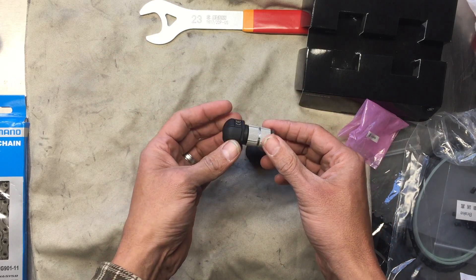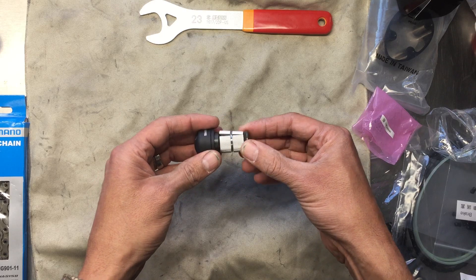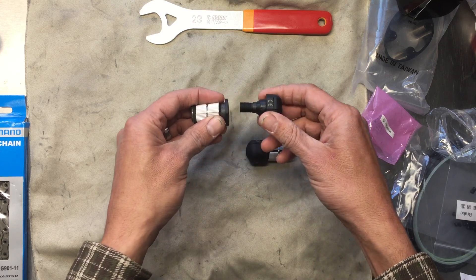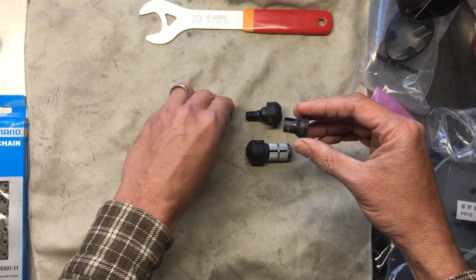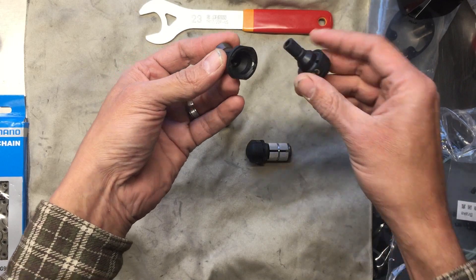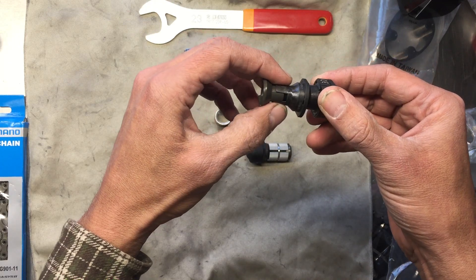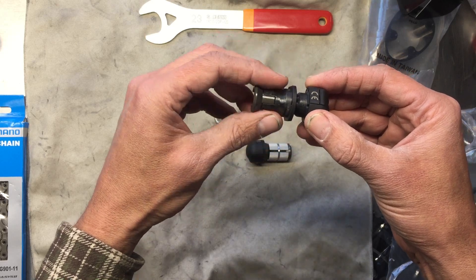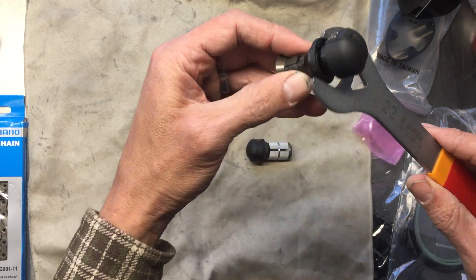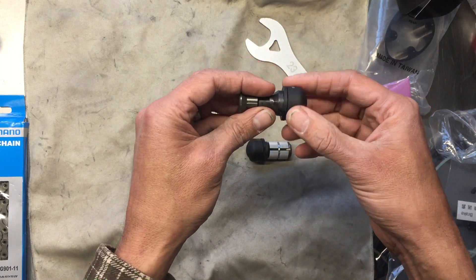I couldn't tell if they come apart. Typically most brake levers and shifters just have a little five-millimeter bolt that tightens up, but upon doing a little research: that piece there is where your threaded section is, and there's a little flat on the right side with two little pieces that engage into the back piece. As you tighten — it's 23 millimeters — you'll need a 23-millimeter cone wrench or spanner wrench. As you turn it clockwise it expands the little silver pieces and that's what fixes it into your extension bar. Your e-wire just plugs right into the center of that piece.